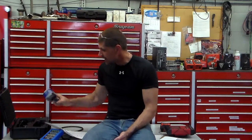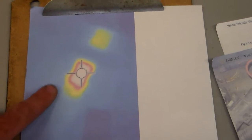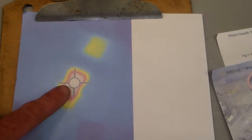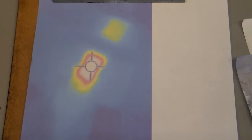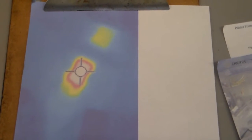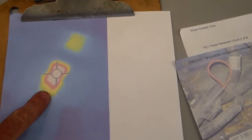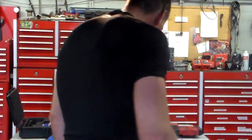Here's what I came up with: a thermal imaging tool — a thermal camera. I really like it because I don't have to touch it. If any circuit on the car that carries a reasonable amount of current has a bad connection, I'll pick it up with this thing. When I pointed my thermal imager at that connection, the blue area was right around 60 degrees and the red area was right about 99 — almost 100 degrees. For me, that is confirmation. The truck hasn't run at all; there should be no heat anywhere. That is my bad connection, and it allows me to confirm the problem without having to touch it, do voltage drops, or disturb any part of the circuit.